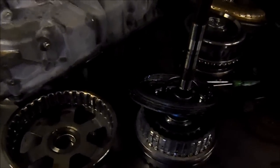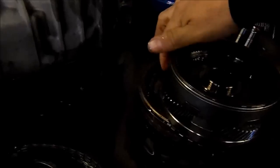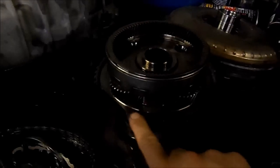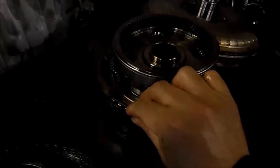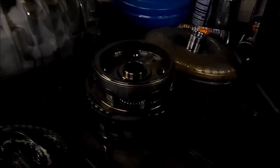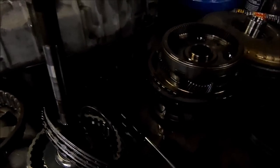If you don't have any other damage, this is basically all that it needs. But here we have a planetary gear where one of those pieces got caught up and it's missing a chunk. One of those pieces probably got hung up in there — and here's that piece. So we need to replace that. The wavy and the clutch pack looks all right, but we're going to go ahead and put the whole kit.